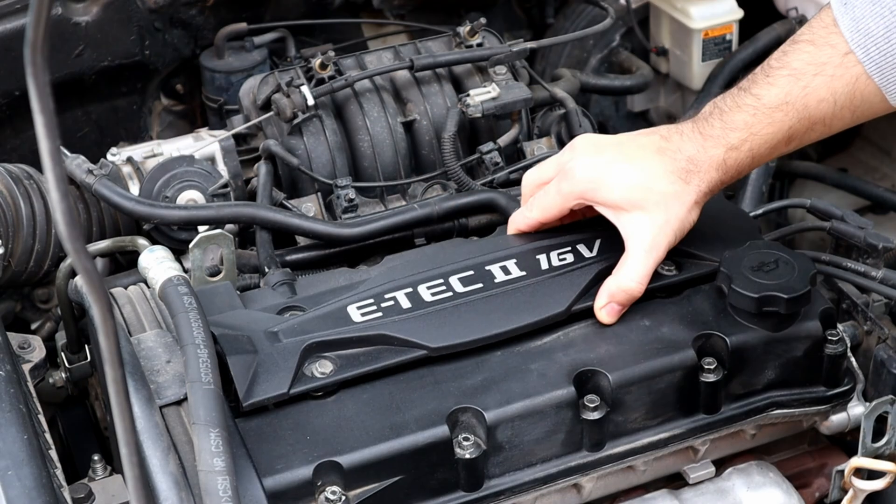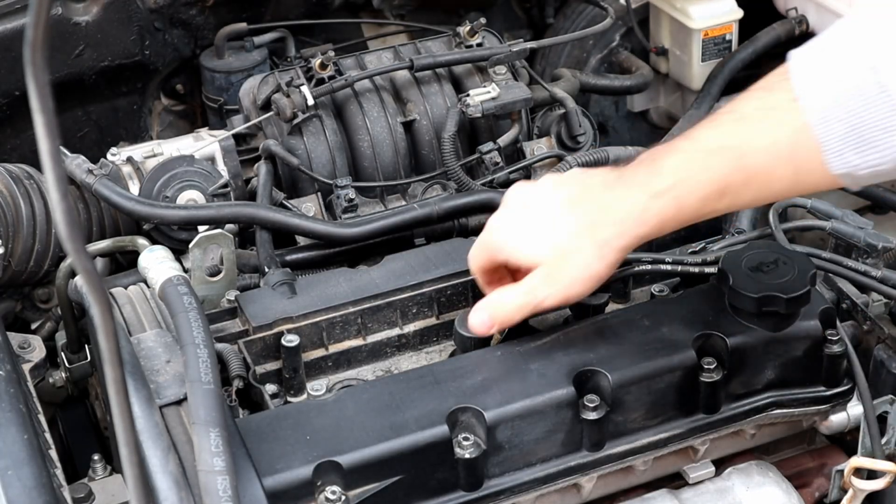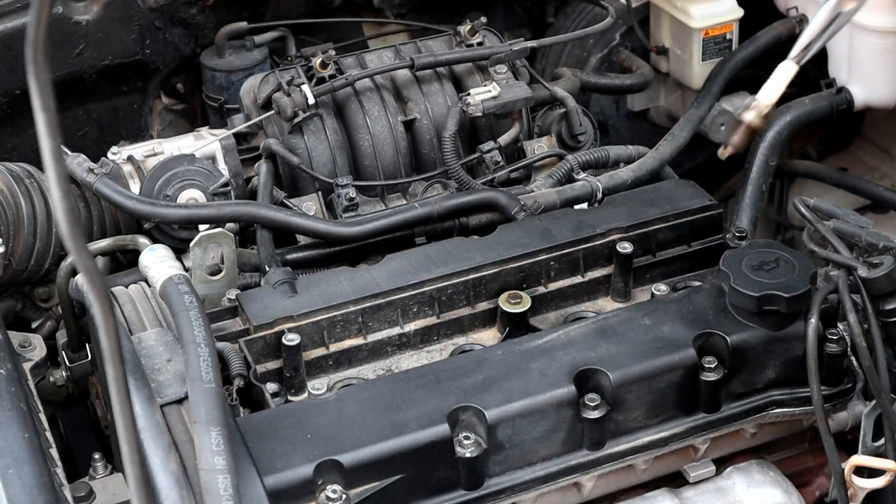It's been a few days and the car has been refueled again. We're gonna take the spark plugs out and see if the lacquer thinner cleans carbon buildup even more, and compare how it was before water steam cleaning, after water steam cleaning, and then with the lacquer thinner. Here are cylinder number two and cylinder number four — looks like it cleaned even more.